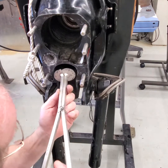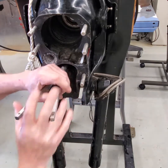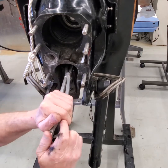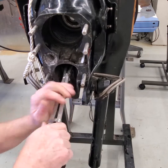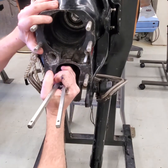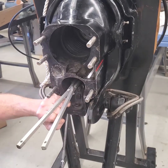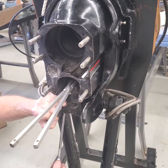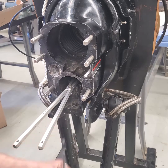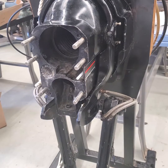I'm going to reinstall this tool, slip it back behind the first rib, spread it again just a little bit, put my hose clamp on here, and slide my hose clamp way in to have a little bit of tension on it so I can hold it on there when I tilt it up. This tool is the only way to get that bellows on — you've got to have that tool. Okay, we've gotten this all set to go.